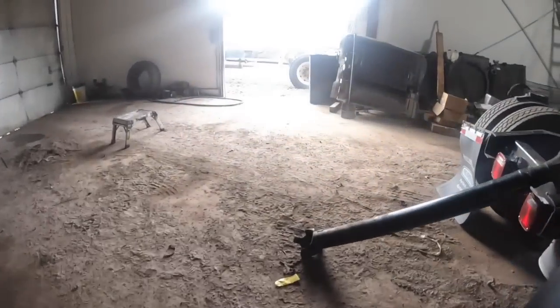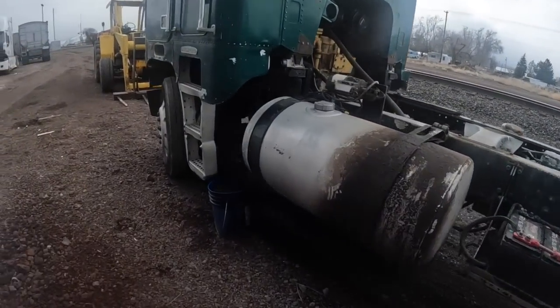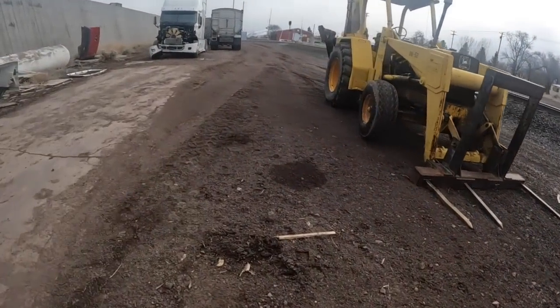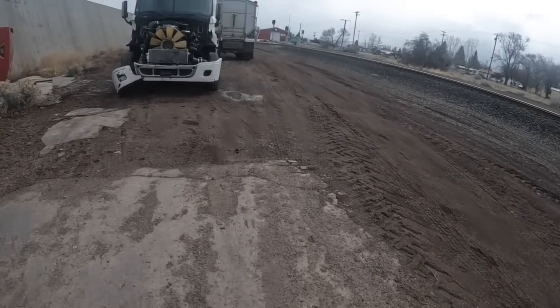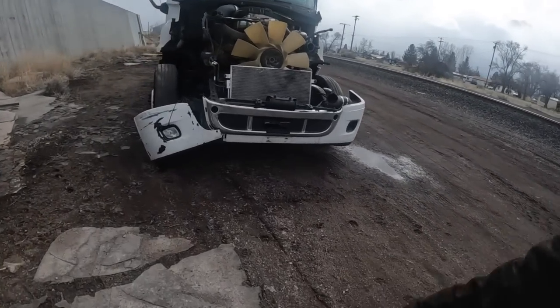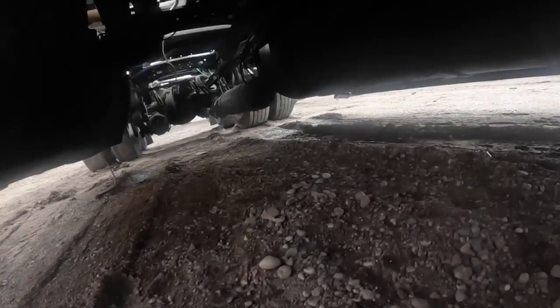I'll show you what I'm running into. That one's obviously the carrier. See, the carrier bracket and mount is way back here. So these are different yokes on this one. If you come out here to this other truck, this old cab over, I got to get this thing in here too. This old B model Cat, I got to get the head off of it and see what happened on it. But look at this one, I'll show you the bracket. And I was thinking about changing the brackets and stuff around here, but I don't know, the easiest thing to do is to get another yoke.